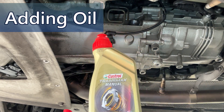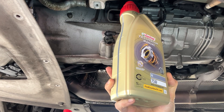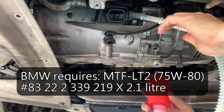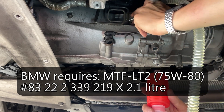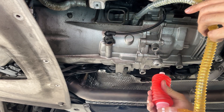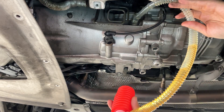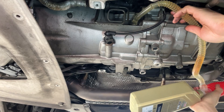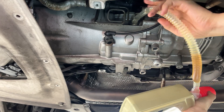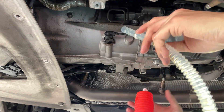This is the oil I use for the manual gearbox: Castrol Transmax Manual 75W. The oil required by BMW is MTF-LT2, 2.1 liters according to the service manual. It is strongly recommended to use professional oil pumping tools — you are going to see how bad I'm doing this. I need to pump another one. Greasy-greasy. Another bottle, ready.